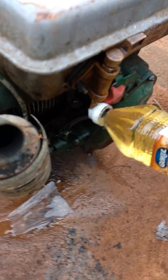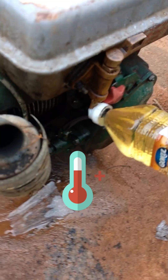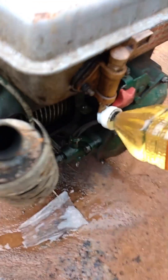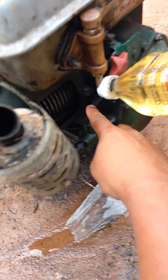This is the reason why in this particular setup I have used normal diesel to start the engine, and then once it's warm I have added a cutout valve and the engine then runs on vegetable oil only. You can see the diesel tank over here and this is where the oil goes to the engine.